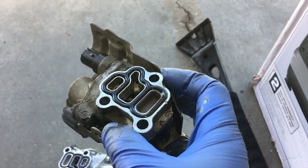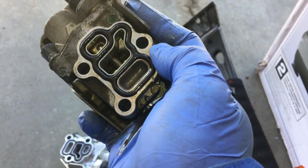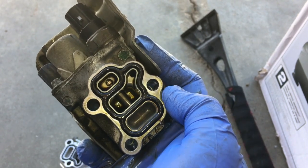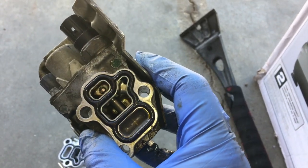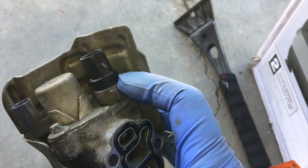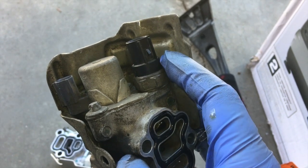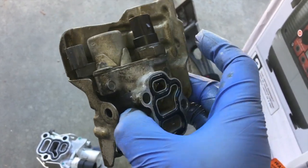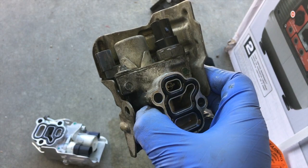Sometimes people have rectified their issues by replacing the whole gasket assembly, which comes with an integrated oil filter screen. Sometimes when the spool valve doesn't actuate it's because it doesn't have sufficient oil pressure, caused by blockage of that screen from dirty oil or varnish. The owner swapped this gasket out with no success — the original screen was actually clean. The oil pressure sensor switch can also go bad at about $150 Canadian. From my experience, you're better off replacing the entire spool valve assembly, because it comes with a new gasket, new pressure sensor, and a brand new solenoid.